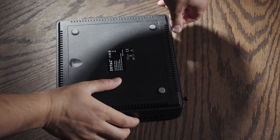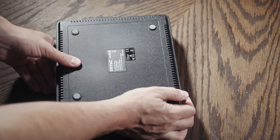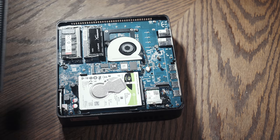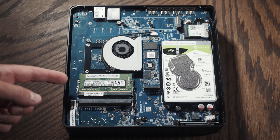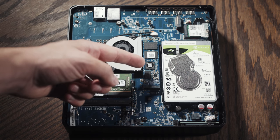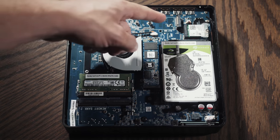On the bare-bones system that you can buy in the US, this is where the included parts stop — you are going to need to purchase and install RAM, SSD, and an operating system if you want a fully working computer. The Magnus is one of the easiest computers I have ever opened up and installed things into. All you need is a screwdriver. Opening the case is as simple as flipping it over and removing two thumb screws. Then the bottom slides off and you have access to literally everything you can install and modify. There are two RAM slots in the SODIMM form factor, a slot for an M.2 SSD, a traditional 2.5-inch spinning hard drive, the Wi-Fi card, and an Intel Optane memory stick slot.